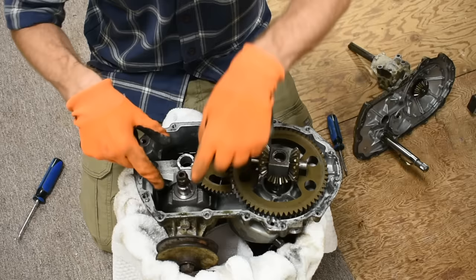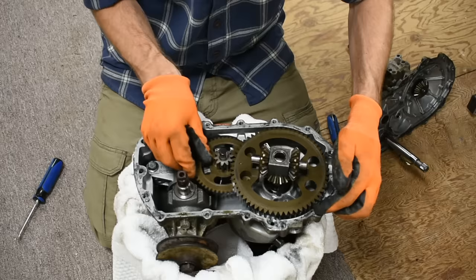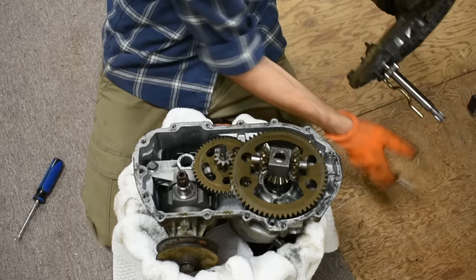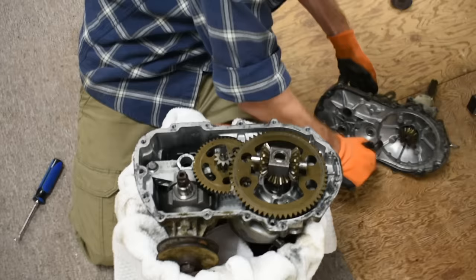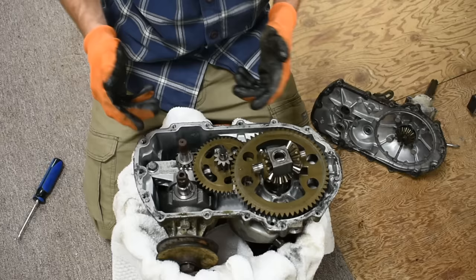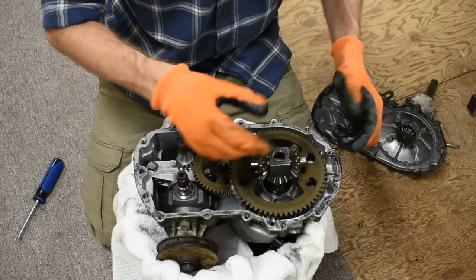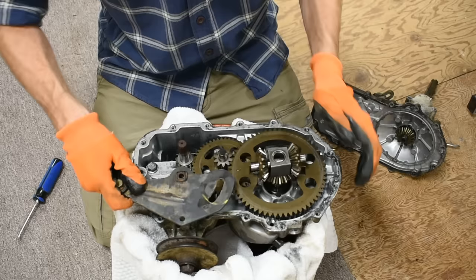Power came in through the pulley up here, and we can see it goes down into this assembly. Here is a set of gears where power comes out of this shaft, which is attached to this gear that fits inside this shaft down here. The power input came from here, and the power output comes through this spur gear through this combination of gears until it reaches this set of gears, which was attached to the two side axles. This plate here is the one attached to the hydrostatic arm so we can use it to change those speeds.